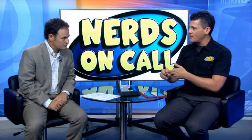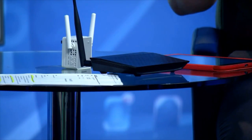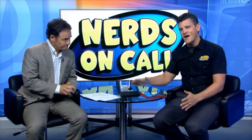So what if you buy a new router? If you buy a new router, what you want to look for is a dual band router. That's the best, because most routers run on what's called a 2.4 gigahertz band. It's a very crowded band. There's all kinds of stuff: baby monitors, cordless phones, Bluetooth, all running on 802.11g or that 2.4 gigahertz. So look for one that's got a 5 gigahertz network. That is going to be a much better network to jump onto, and it's not as crowded.